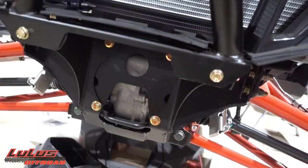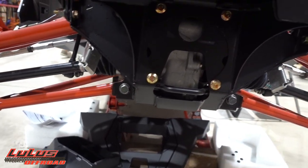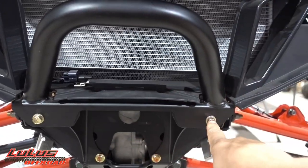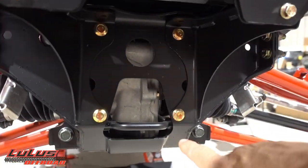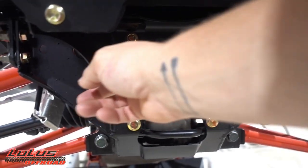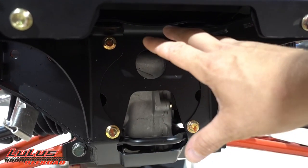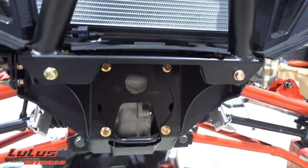I've already removed the plastic cover shroud. Basically you're left with this pull bar — literally these two bolts are going to pop that thing off. Then you have these four bolts right here that are going to remove these two brackets. The new bumper literally has a whole new framing and everything that's going to replace this.